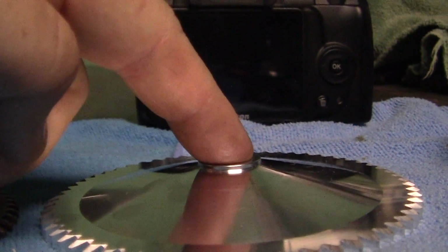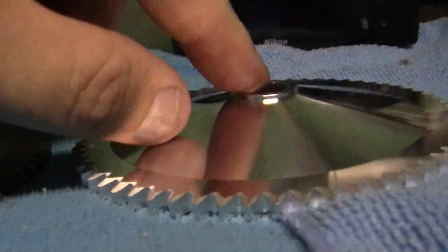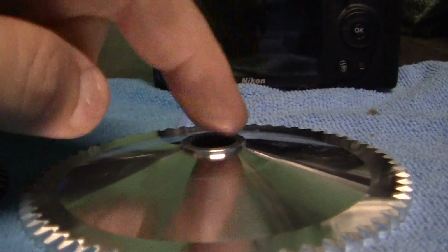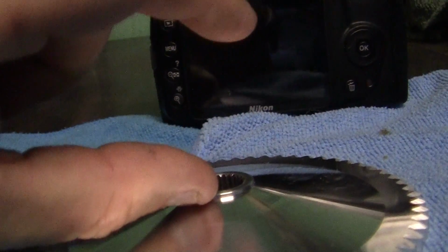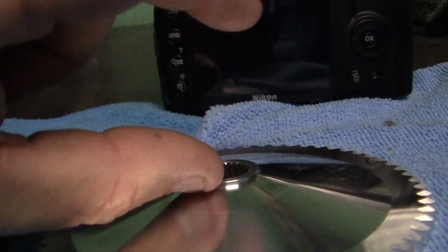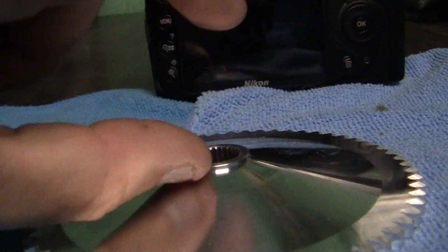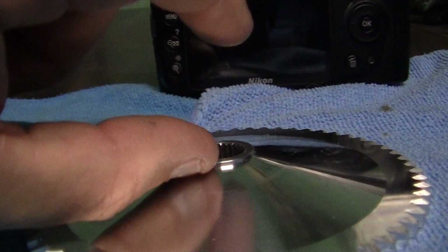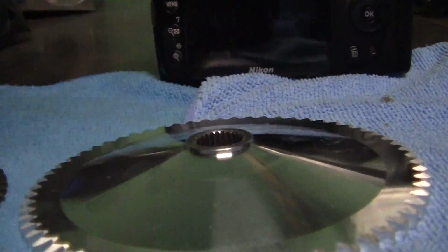And what you have here with the ZX kit is a smaller pulley boss, or the pulley boss that rides right around here, the chrome piece. It's not the regular one, which is about that tall. Your pulley boss on the ZX is thinner or smaller, so that the faceplate ends up in the right place.